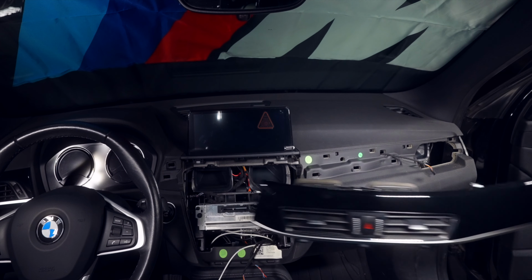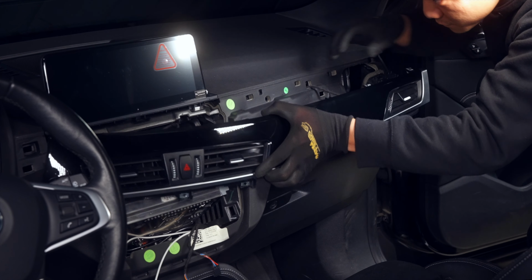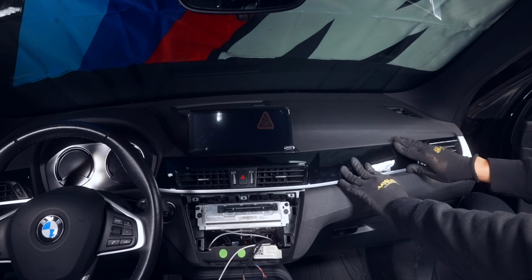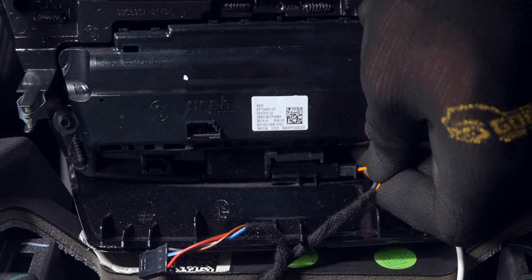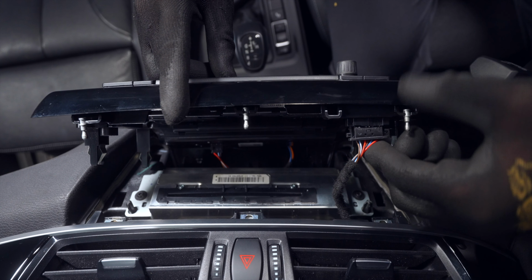The top trim goes in first, and this is the one that had the ambient lighting connection as well as the lock and hazard lights. Then line up the tabs and press it in. The bottom trim had 3 connections, all of which have their own distinctive harnesses. Then align the 3 top pins to the respective receivers and press it in.